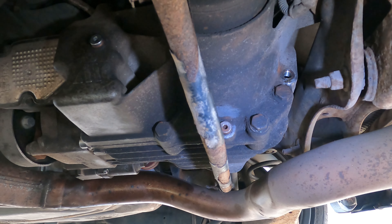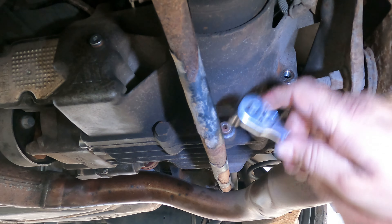Also remember to do this whilst the car is level, and now we're removing the drain plug. The fluid is never really that bad on the rear diff as these are Haldex and mainly front-wheel drive until the rears need to kick in, so the rear fluid never looks as bad compared to the front. Fit a brand new plug and torque that to 15 Newton metres.